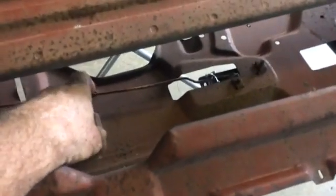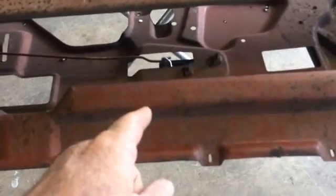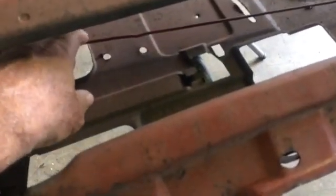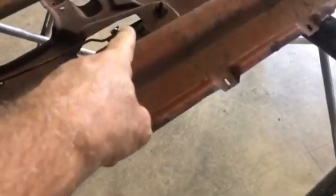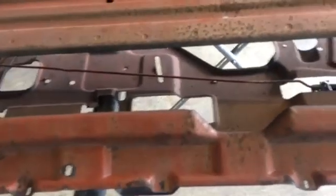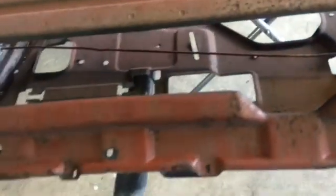One thing I was noticing about this rod, when you try to open the door, and I had it adjusted out pretty good, I think these rods tend to stretch in these bend areas. And it looks like there's a little bend there, and then of course there's a 90 there. The best I remember years and years ago from other cars that had this same rod pull type deal, they'll stretch a little and it makes it kind of hard. I could engage that handle from the inside all the way back and then just move this a little with my finger and it would pop that door. So that rod is definitely stretched. I'm sure they're available, but I feel like I can probably whip that back into shape where it'll work good enough.